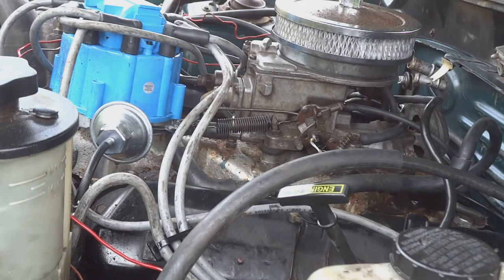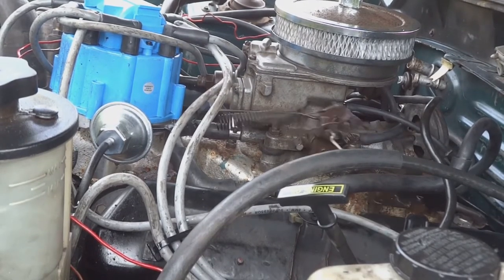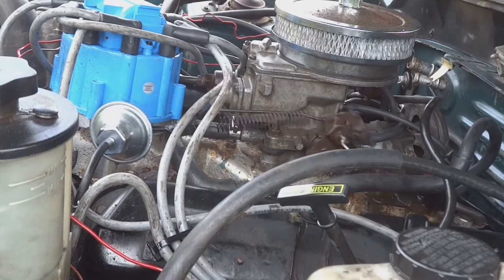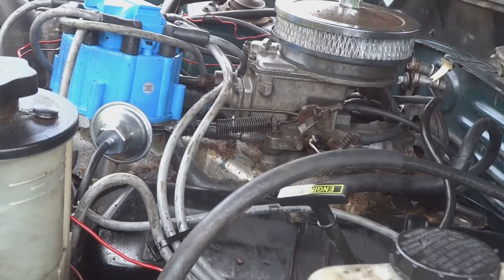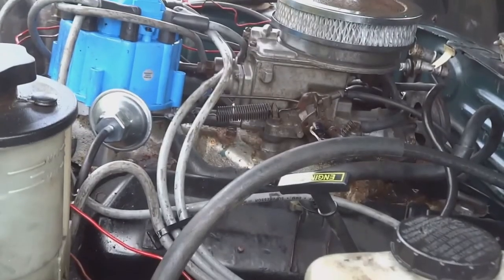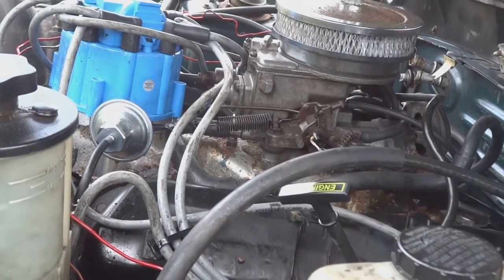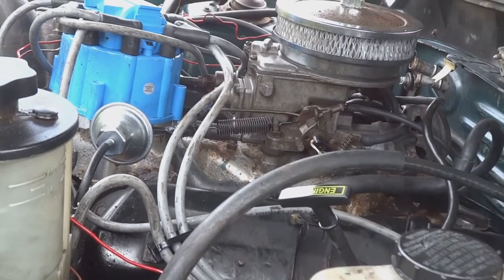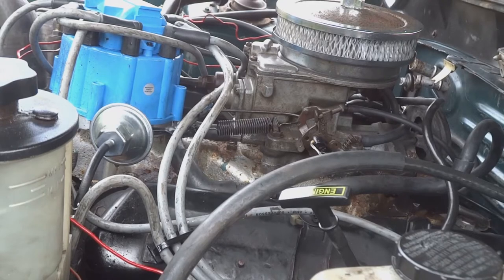Let's see how it looks if I was to press the throttle in the car. I want to see how it feels. That's me pressing it in the car. It actually feels really great. It feels perfect, actually. And I got that spring from one of my friends named Shane. He took it off of one of his Corollas. It was for the brake pedal. So that's a brake pedal spring. Works perfectly as the spring for the throttle body.